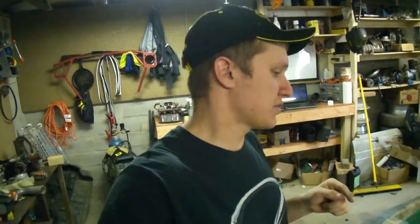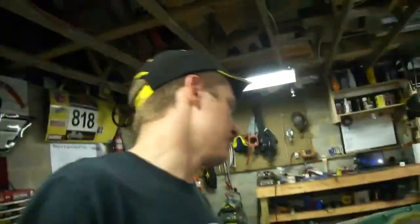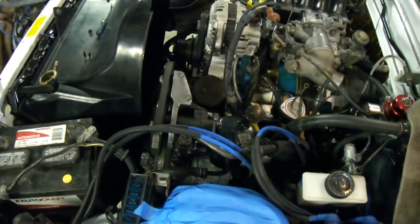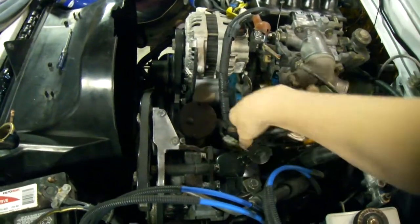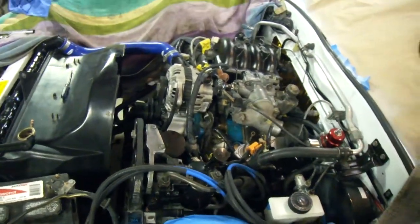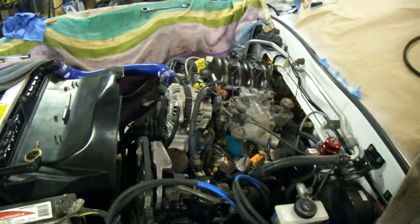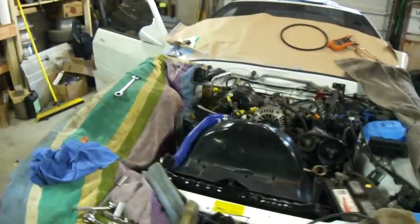The vert runs for a little bit, which I shut off with the key, but it runs so now we're good to come out here and button up the rest of everything, get some coolant in this thing. I'm going to tidy up all this extra wiring that I don't need. There's a lot of emission stuff we're going to get rid of, and we're going to fix the big glob of wires that's in there, so we'll pull the intake manifold back off and tidy it up.